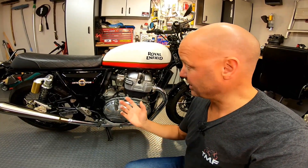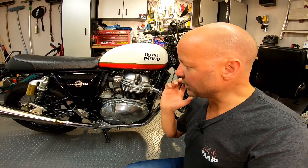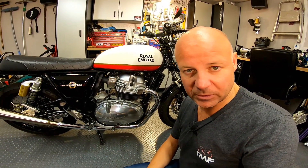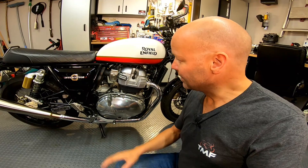A couple of reasons. One, it's rumoured that the stock air filter doesn't actually allow the bike to breathe very well. We'll have a look at that setup in a minute. So I'm going to put in a slightly better filter that allows the bike to breathe a little bit better, and also it's a washable one, meaning you don't have to replace the air filter each time you do a service. It's a bit like what I did on the old trusty CRF a few years back.